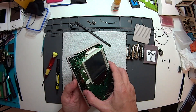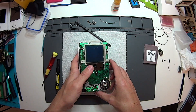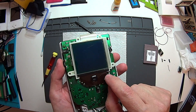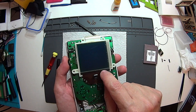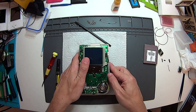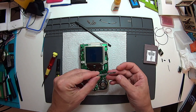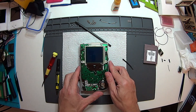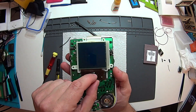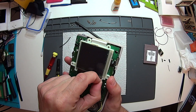Okay, so that's now apart. What you can do when you've got it separated is keep the back together, pop the batteries back in, and it will actually function while allowing you to access this area. On here there's a little rubber strip that keeps everything protected, and when assembled it keeps pressure on the ribbon — because the lines come from those layers being separated. I'll peel that back. It looks like the tape was slightly misaligned, which is fine. So you need to remove that rubber strip, which is attached with double-sided tape, and remove any remnants with a fingernail or spudger.